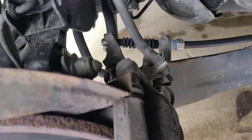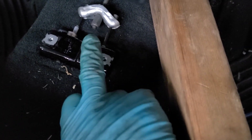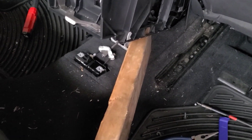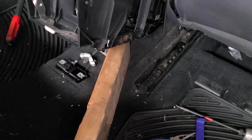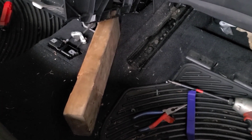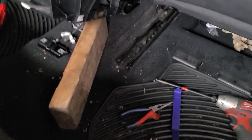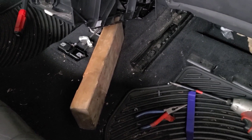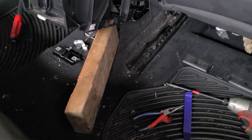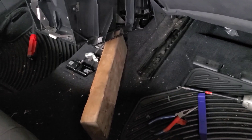On the right side I was having a little bit of trouble hooking the cable back onto the caliper. What you need to do is back off this adjusting nut until you're able to hook up the cable, and then readjust the cables so they'll release when you release the lever — so the wheels spin freely — and when you pull the lever and add tension to the cables, the wheel will hold. You'll just have to test it and feel for the best adjustment.